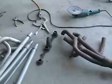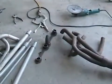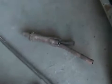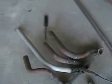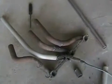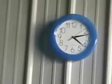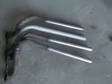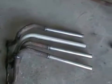Let's get busy. Now I've just wrecked a perfectly good pair of headers to start the beginning. Chop chop. Not much left of my header now. Now I've got that contraption, which needs more pipes added to it and lots of little spot welds. I'll do up all the spot welds solid now and add extension tubes. Cool. Two hours later, all welded up and made extra long. Now I've got to install it and trim all those long edges off on an angle to length.